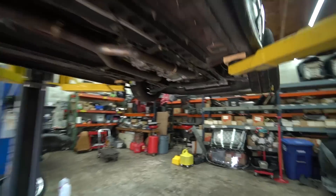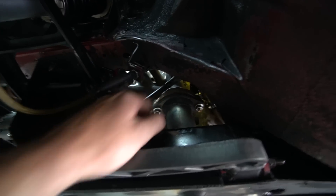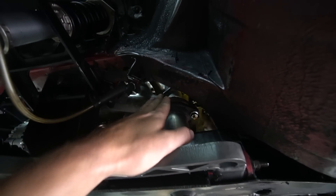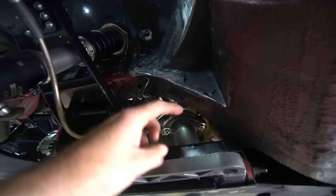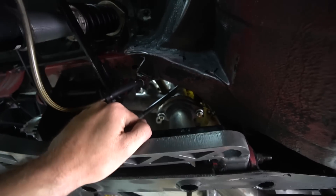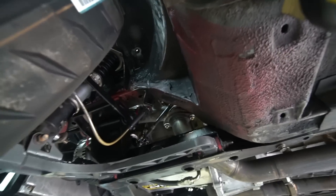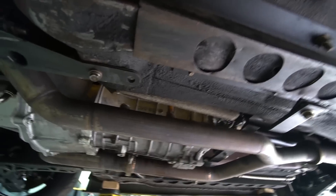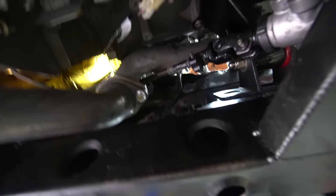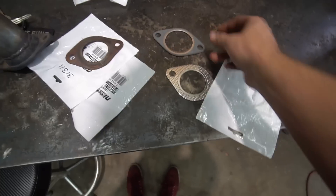Something I noticed - I think I've always had one on this side, but it seems really bad now. There is a massive exhaust leak coming from where the header meets the collector. You can feel it with your hand with it running - you can just feel the exhaust coming out. The problem is these are G8 manifolds, and these normally have a thing with a donut crush sleeve. It's kind of hard to find the right gasket. I managed to find a gasket that will work at the auto parts store - this one was close but it's a little too small, unfortunately.